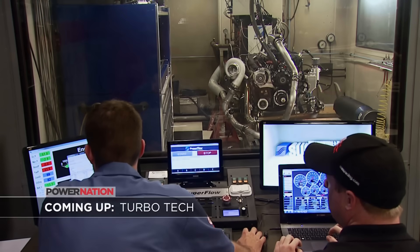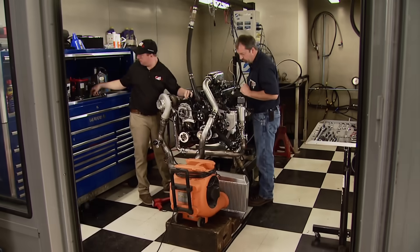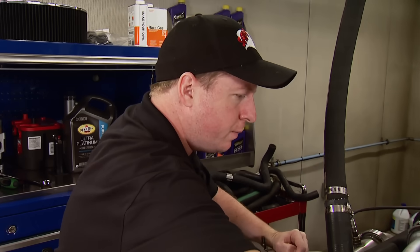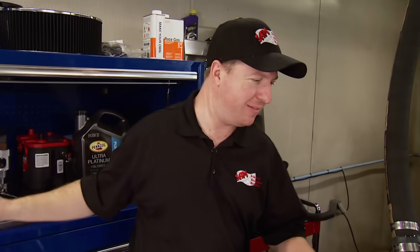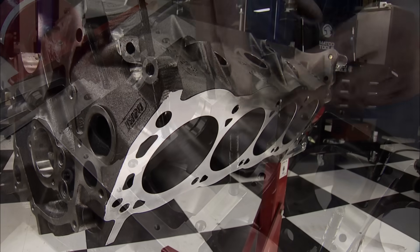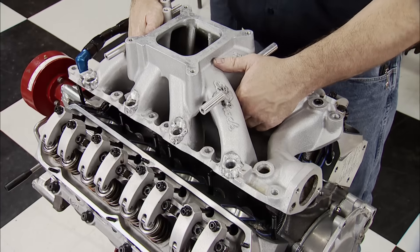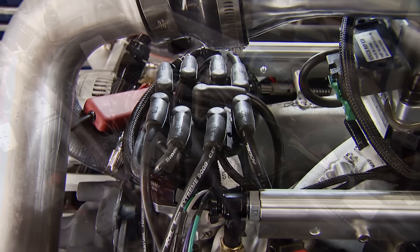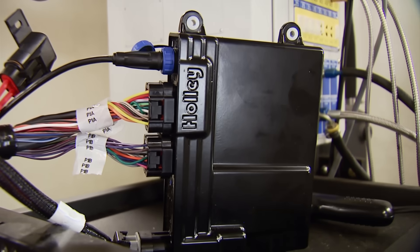A familiar face is in the house to tune the turbo small block. Chris Bennett is here from the School of Automotive Machinists — he and his team already had their hands on it. Dart sent the block per their direction; students checked the block, line-honed it, bore-honed it with torque plates, and checked the deck. The cylinder head class was responsible for converting the intake manifold to EFI, welding in the injector bungs and fitting the fuel rails. Finishing the engine off is an MSD dual-sync distributor controlled by a Holley HP EFI fuel injection system.